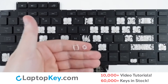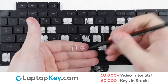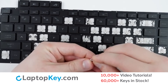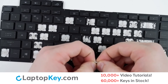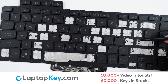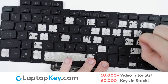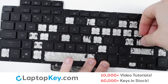To begin reattachment, start with your clips. On the bottom clip, there are two notches towards the top, and on the top clip, there are two holes towards the bottom. Connect the two together by feeding the top clip through the bottom and clicking the halves together. Then using metal hooks here and here on the board, use the arms on the bottom clip to hook in and lay down flat with a slight push to the clip.